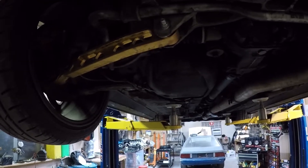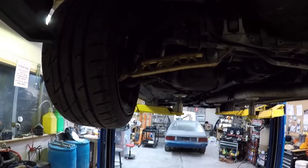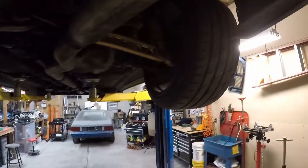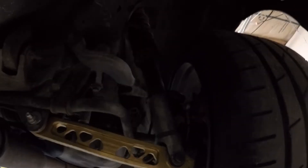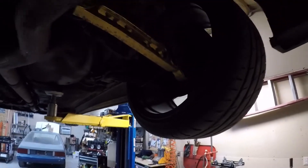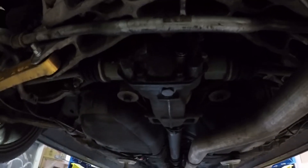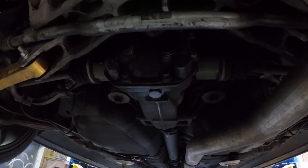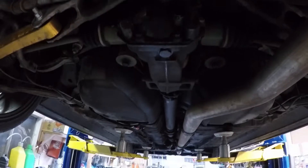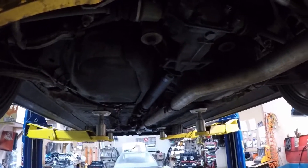The lower control arms on my car have been upgraded to aluminum lower control arms — I believe they're DD is the company. They've been really, really good quality with no issues whatsoever. I've got the Megan coilovers basically all the way around on the car, with stainless steel brake lines for the STM staging brake. My braking system is mostly stock — I do have the stock front and rear Brembos for calipers, and I'm just running some golden slotted rotors. My rear diff is actually out of an Evo 9, and a good friend of mine, Jake Montgomery, actually plate-swapped this rear diff for me. It's one of those things I need to be upgrading and it's on my list for future replacements.